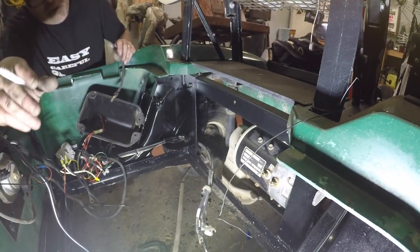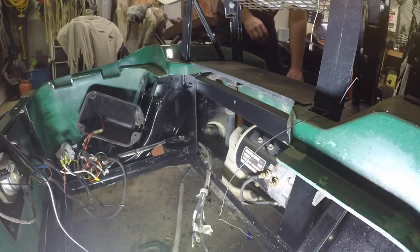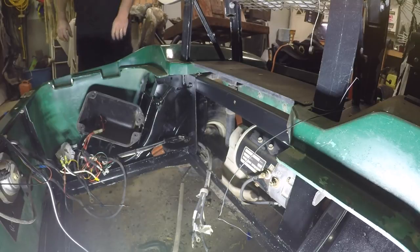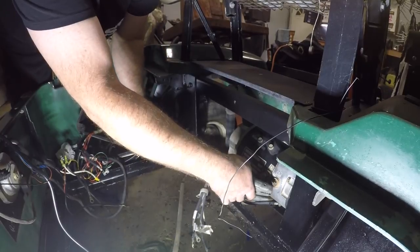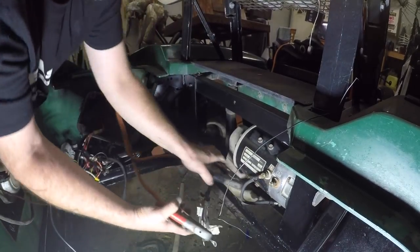So to test this motor, what we want to do is go from S1, which is down here around the corner, to S2. So now what we need is just some booster cables and we can see if what I did fixed anything at all. I'm going to use my 12-volt battery off the old Yana over here. We want to go ground to this one, positive down here, and see if we get turnage. Oh — we got movement boys! Hey, she's working! Forward — so there you go boys, that motor's working now.